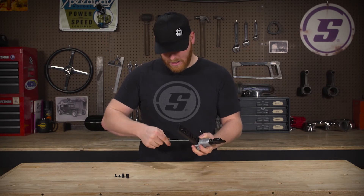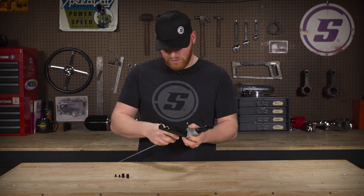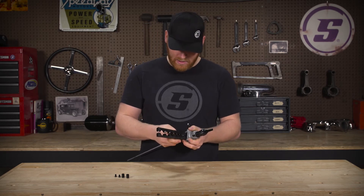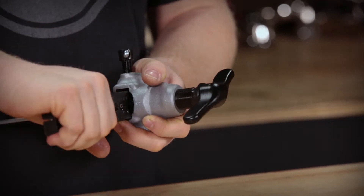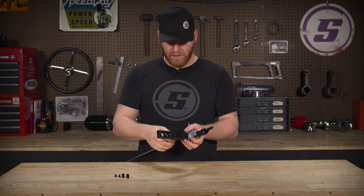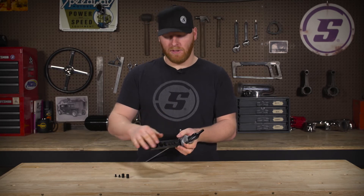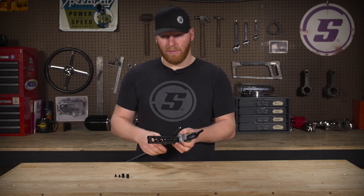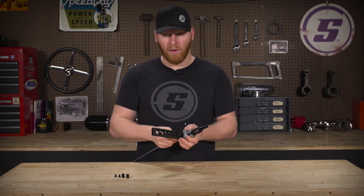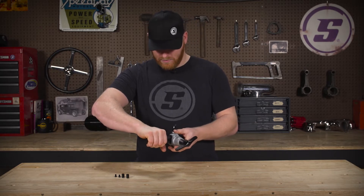With the brake line, you're going to want to open that up a little bit. You're going to want to set it about even with the top of the die — that's going to give you a pretty standard size flare. If you need a little bit larger OD on the flare, push the brake line out above the top surface a little bit. If you need a little bit less OD, just do the reverse and drop it down below that top surface. For here, we'll go ahead and do a standard size flare.